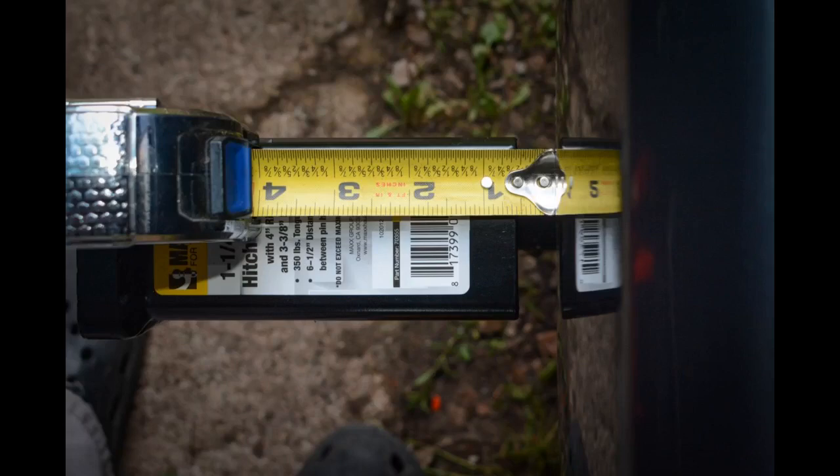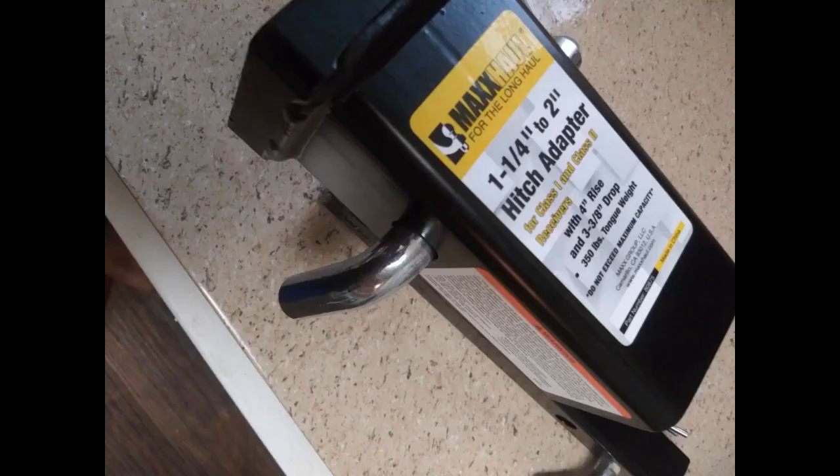I purchased a 2.5-to-2 reducer and had it welded onto the Ford lift adapter, staggered out from the bumper, and now it works great. See photos attached. For these tweaks I give this a 4. Easy lift on and off is nice.